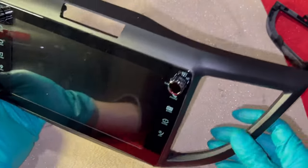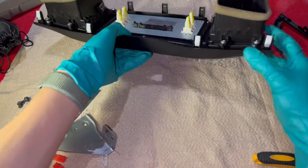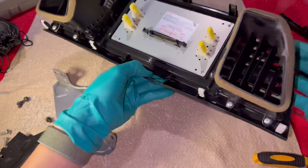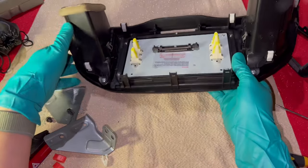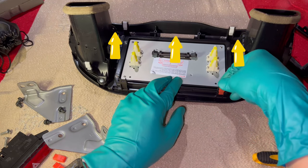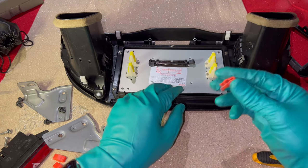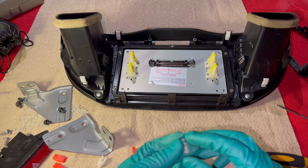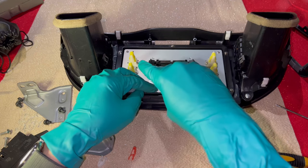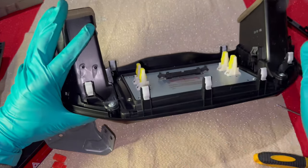Do the same on the other side. When both vents are connected, notice there are fewer white clips mounted on the top part of the frame — they got rid of three white clips total: one from each aircon vent and one from the top middle section where the hazard light is. That leaves three extra white clips for the bottom section, because the red clips don't seem to fit anymore — so in the end you'll have three unused red clips.